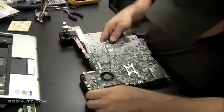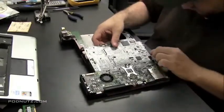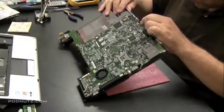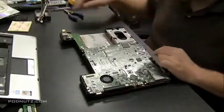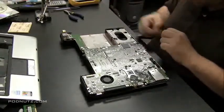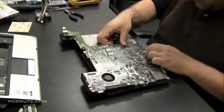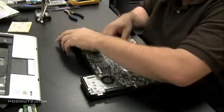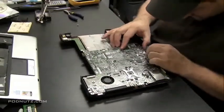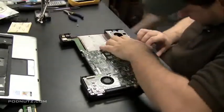The only thing you've got to worry about is: now that you created that wire and put it into the circuit board, is it going to stick out? Is it going to make a connection? Is it going to short out part of the motherboard? If it does, you have to secure it with electrical tape, cover up the connections you created, and also create more space — which is what I did with the pliers. Now it looks like everything's fitting better.